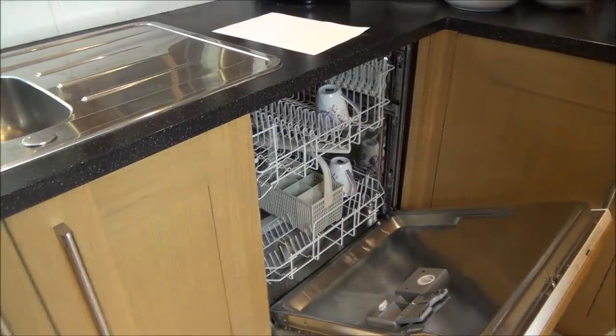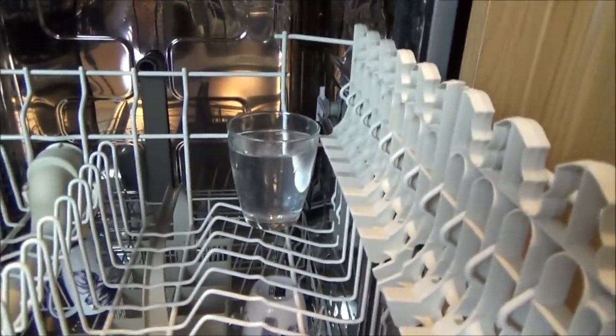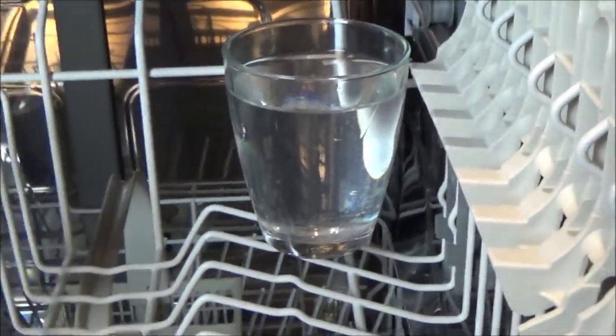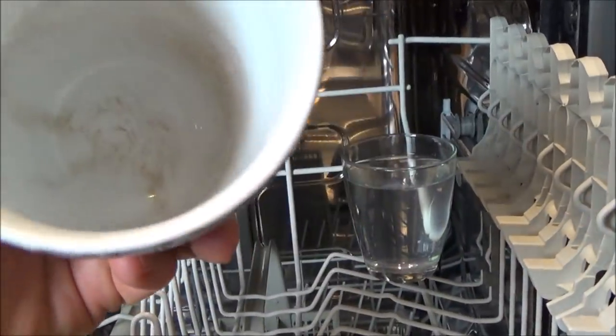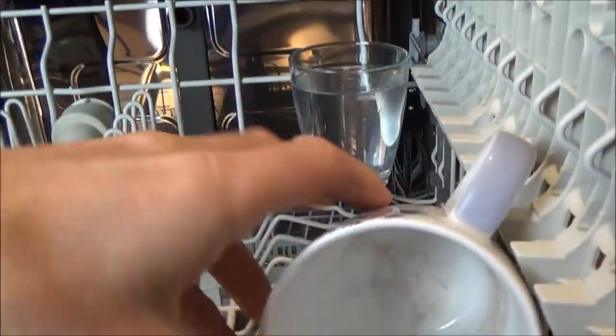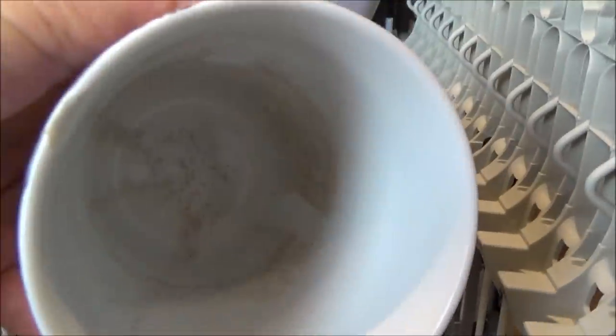Just to test it, we put some cups in — the correct way up but the wrong way for the dishwasher. You can see this one here has had hot chocolate in it and it hasn't cleaned any of that off. If I wipe it with my finger now it comes off easily, so clearly the spray is not getting in there. And I know there's nothing wrong with the heater.